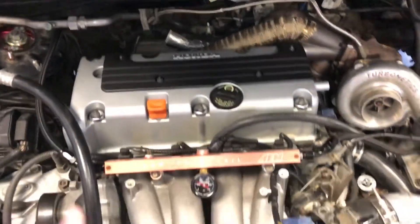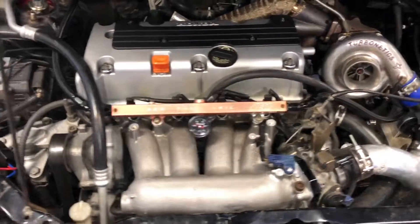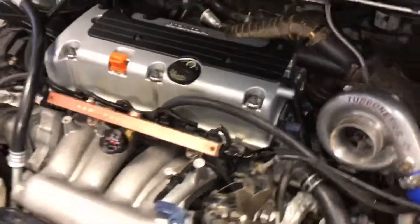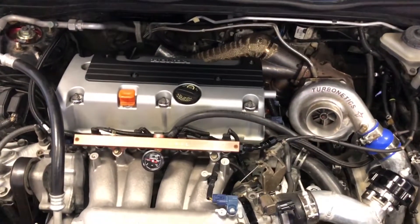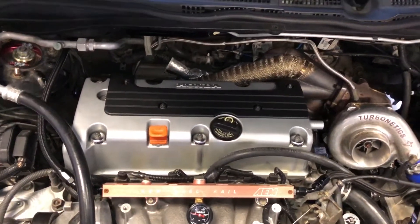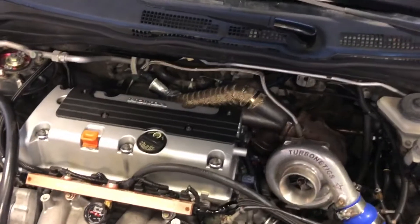The things I found out — which I did not know when I got the car: the block is a K20A2 from a 2004 RSX Type S with 122,000 miles on it. The head — you can see the RBB2 casting — is actually a K24A2 head. And this is what really made me happy: it has Crower Stage 2 boost cams, Supertech dual valve springs, Supertech titanium retainers, and ARP head studs. The head is fully built, which I didn't know when I got the car. Some good surprises.